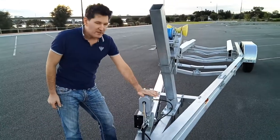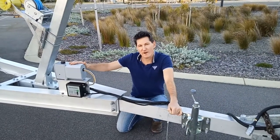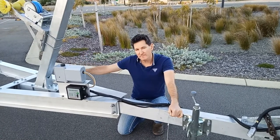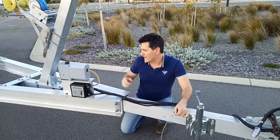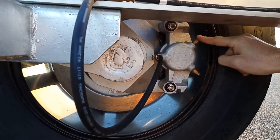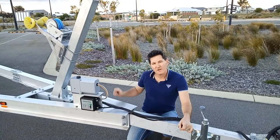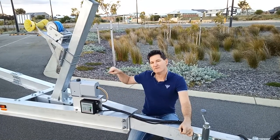Once you connect your hydraulic line to the actuator, you can then bleed up your brakes. Put your hydraulic fluid in the actuator — DOT 3 or 4 depending on the manufacturer's specifications — and you're ready to bleed the line. The easiest way is to use your breakaway switch, which will charge the line. You'll need to bleed the air out at each caliper using the top bleeder. You'll need a friend — one activates the pump, the other cracks the bleeder to extract the air. Once done, tighten it back up and repeat for each caliper.